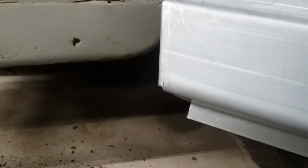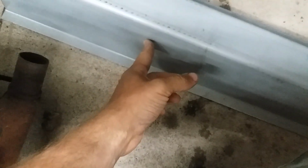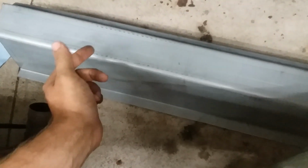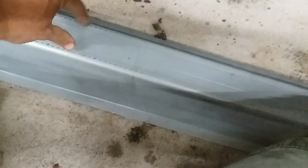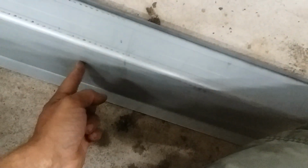Well, this wouldn't look right at all if I put it on my car. I don't even know if it would fit. That's a gargantuan difference, man. But there are other issues. Like this panel here is about 1/2 inch too short, and they could fix that easily just by changing their template. Because this right here is only 1/4 inch too tall. So if you move this bend further this way, that means you'd have a closer length here.